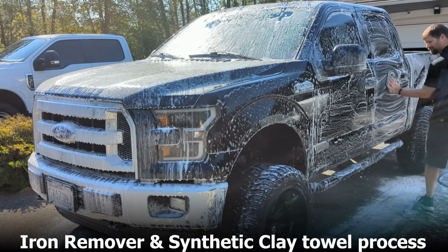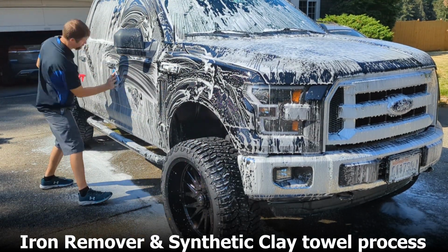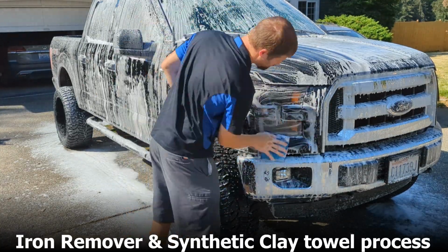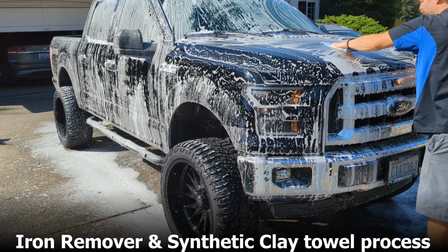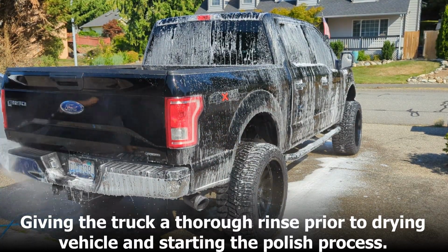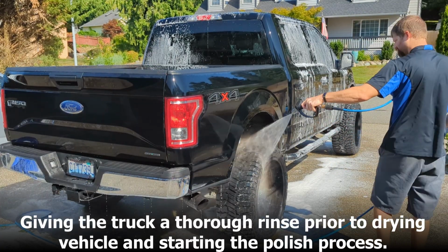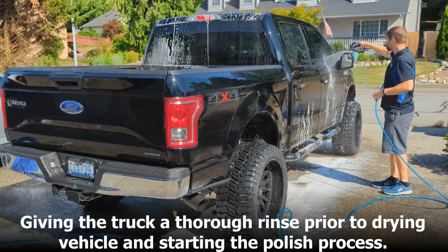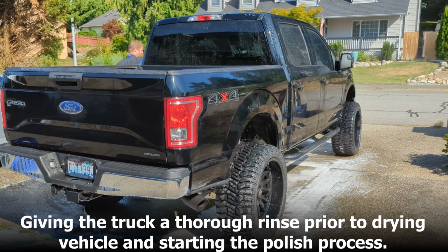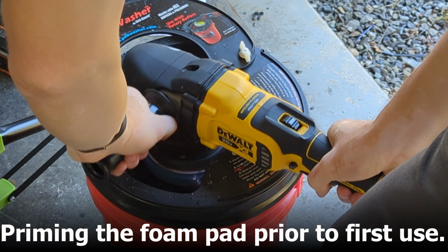Even with this bigger lift and the bigger wheels and tires, this thing's sitting on 35s. My F-350 is sitting on stock 33s, and it doesn't have a lift at all. I think the F-150 is maybe 2 inches higher than my F-350, so it kind of goes to show you how much bigger and taller and heavier duty the F-250 and 350s are compared to the 150s. But a lot of the F-150s are fine for almost anything that people need to do. If you're not towing real heavy or you don't have big payload, it does great. Only thing with the F-150s is if you are towing any sizable travel trailer, and you've got a family in tow, you're likely to go over your payload, especially if you're bringing camping gear and stuff. It's pretty easy to go over.